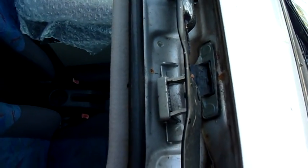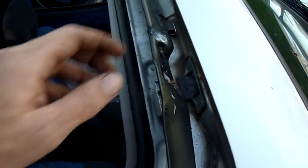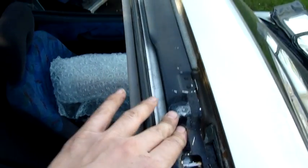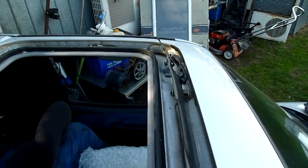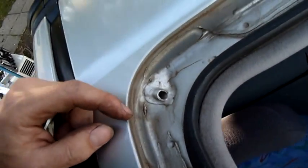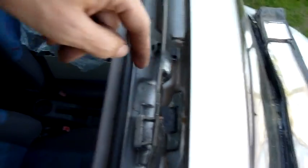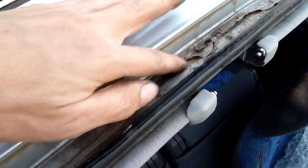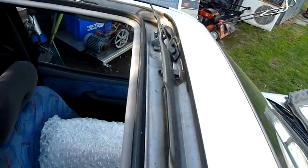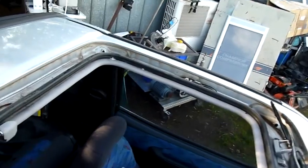So it's a draining issue, which is just what I need. I'd say the drains are blocked. I've got a roll of fiber optic cable that would make a nice drain snake — it's stiff enough. I think as the vehicle's moving you get airflow from the front pushing water out the back, but when it's not moving it doesn't flow. That hasn't breached yet but I'm going to get onto that. We've got a water backup issue, but the seals have held out — they haven't leaked into the cabin.